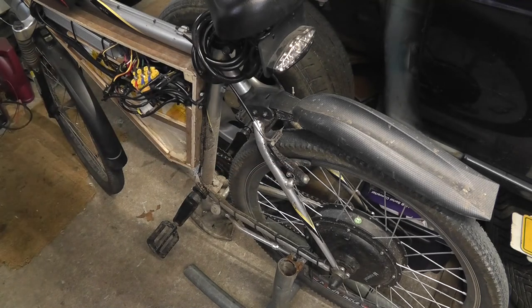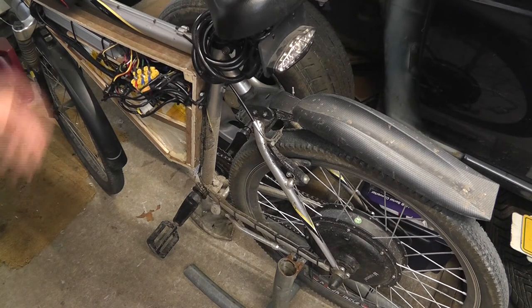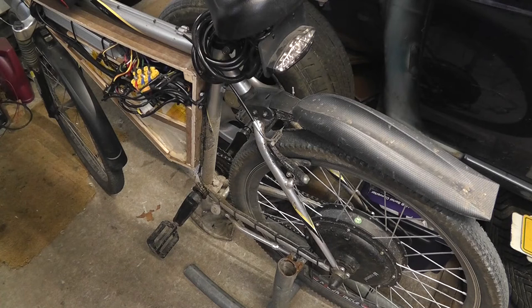Here's all you need to do. First thing you need to do is to disconnect the battery from your controller. The reason you're doing that is because you do not want, under any circumstances, you do not want this controller to burst into life and start spinning or trying to spin. I know that's not very likely, but for safety's sake, disconnect the battery.